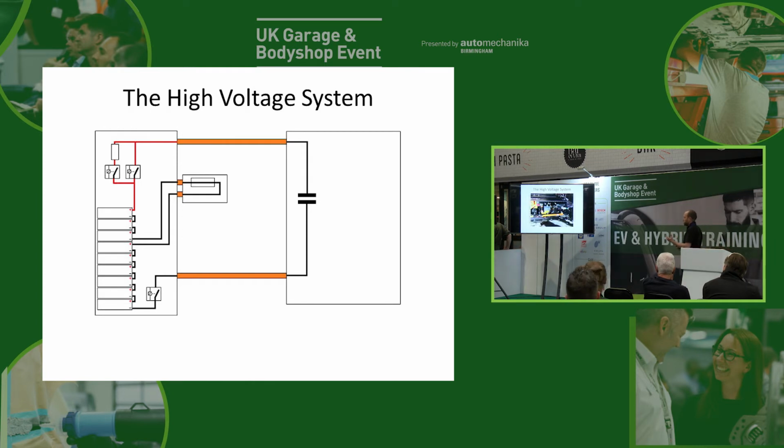And inside the vehicle, this is a Renault Zoe battery pack. This is how it's all laid out. This red terminal here is our permanent live in the battery, if you like. That's got 350 volts on it all the time. And you can see the various protection devices. We've got a nice 275 amp fuse. Then this is our pre-charge relay, this is our pre-charge resistor, and that's our main relay or our main contactor. And that all lets power come out, and then obviously that connects the rest of the battery up to the rest of the car.